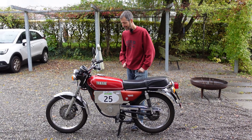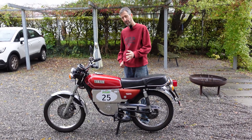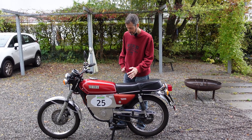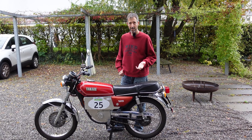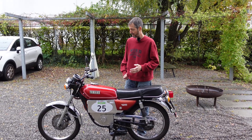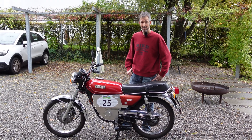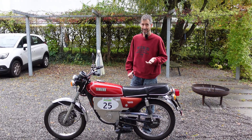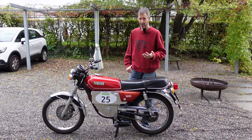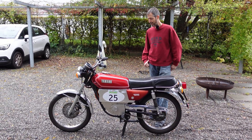The battery I built myself is about three kilowatts. It takes you 50 to 70 kilometers on one charge. I put in a 10 kilowatt motor so I still have the same power the original bike had — I didn't want to lose any power, but I couldn't make it stronger either otherwise I wouldn't be able to get it through the road tests. That was maybe the hardest bit. When I started the project the first thing I wanted to know was whether it was possible to do something like that at all in Switzerland, and yes — switching the engine is something you can do as long as it's not dirtier than before, which is no problem with electric.